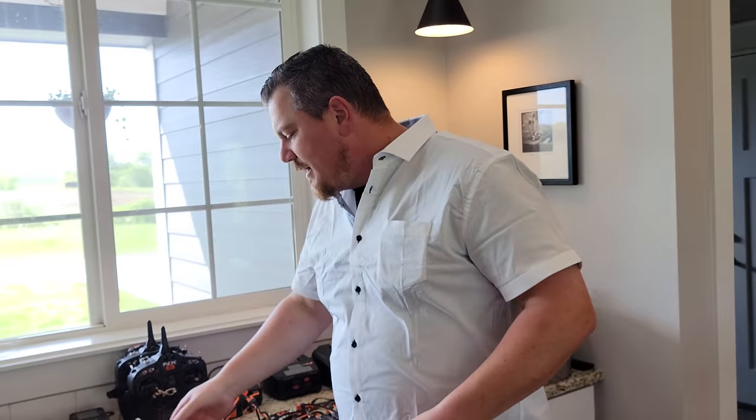So in our case, what we need to do now is mark the CG. The CG is at 65 to 75 millimeters back from the leading edge inboard. So we're gonna grab a marker. It's gonna be kind of awkward. Test. Yep, and if I recall, this thing is really not picky, but 65 to 75, correct? Mm-hmm. Okay, so 65, you're not just being agreeable, that's actually right. No, I read it. Okay, so 65 to 75.